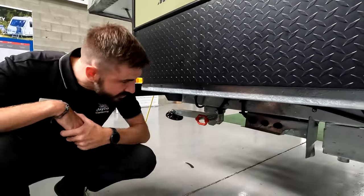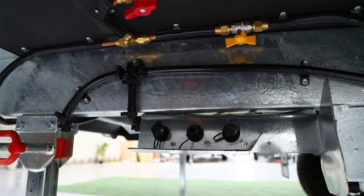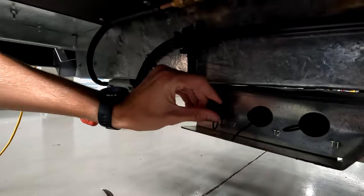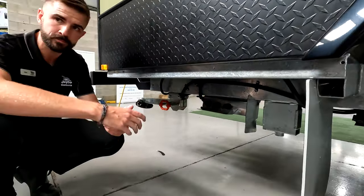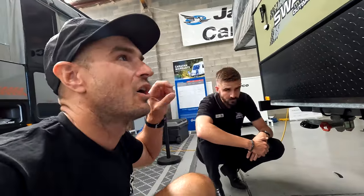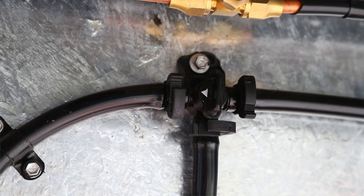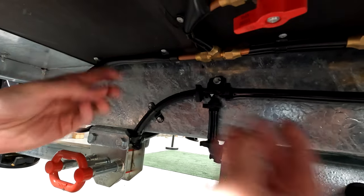The new mains pressure fill is a big improvement. Before you had to shove the hose down the hole into the tank and fight the water pressure. Now you just connect it to either the front tank or the rear tank and it fills up. Then you've got mains pressure — if you go to a caravan park and want to use their water, just connect it and it bypasses the tank and goes straight to your sink and front tap. The T-intersection fitting controls which tank you draw from: facing rear is rear tank, middle is both tanks simultaneously, forward is front tank only.